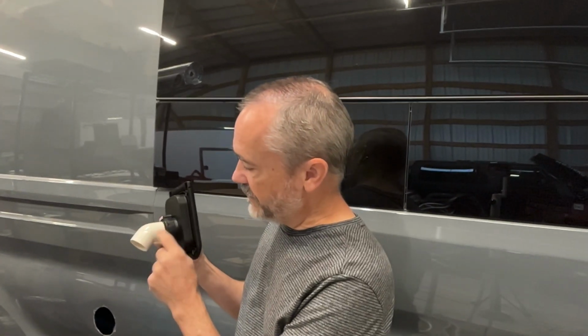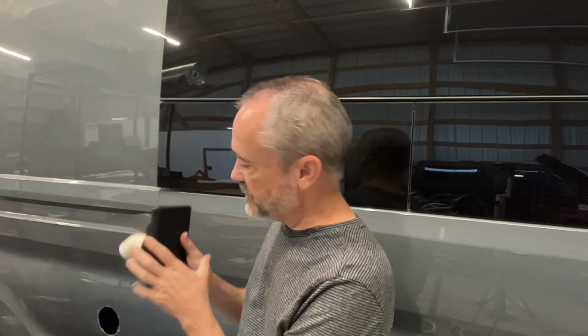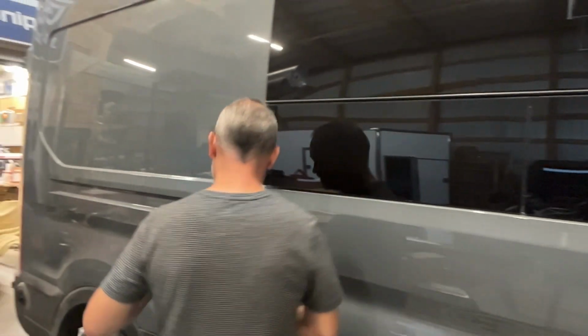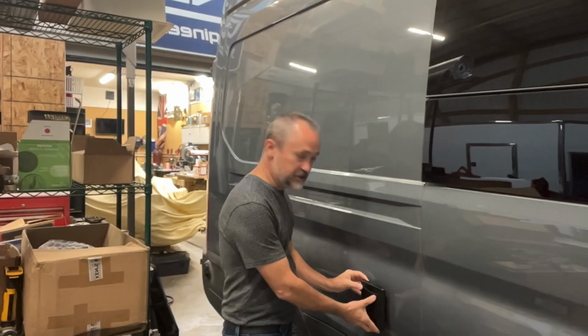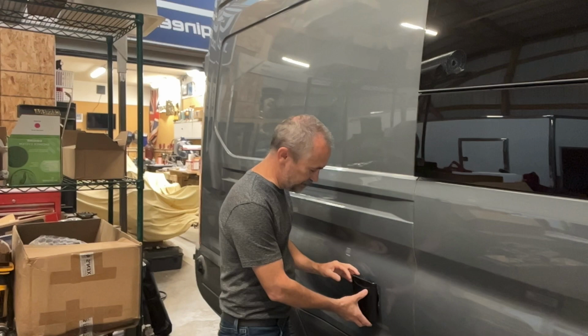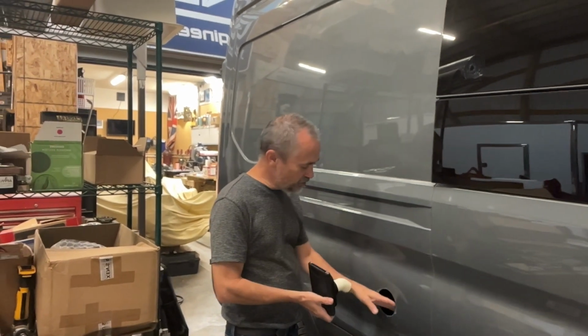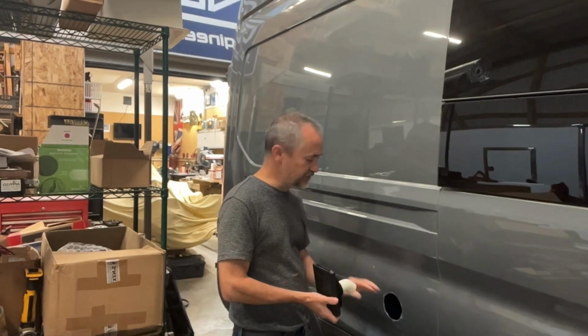This also has then a 45 in here. I'm gonna switch this to a 90 just because as this goes down, it still is fairly close. When you put it into the opening here, it gets close to the back there. And that's really not what we need. We need it to have a little bit of a better turn so that way the hose will go and exit out the bottom better. I really want to stay within the wall part of this instead of going inside.